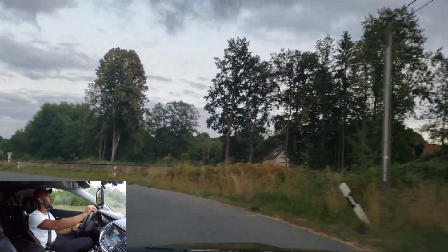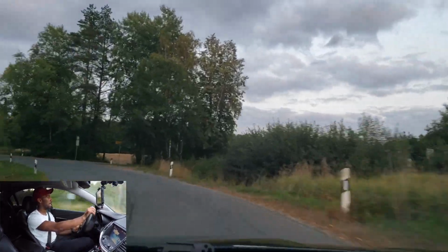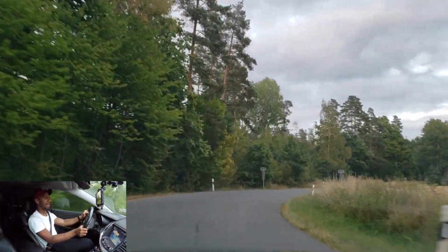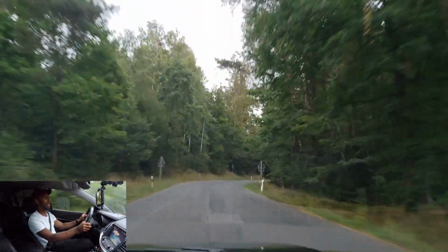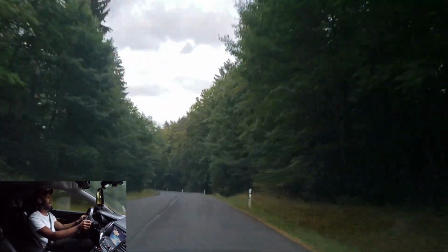This car could definitely benefit from a pad upgrade, maybe some stainless steel lines, some good fluid, just to help bring it down a little bit from a stop. I'm actually surprised they didn't put the CTS-V 6-piston calipers. Probably would have been a slightly better fit for a car of this size, but it's still dancing around. I like it, honestly.